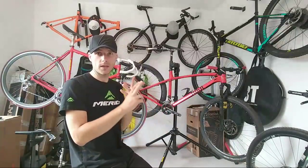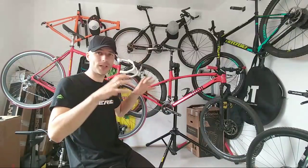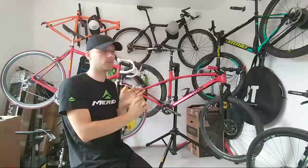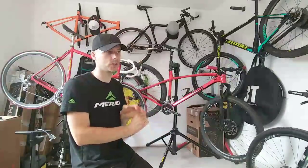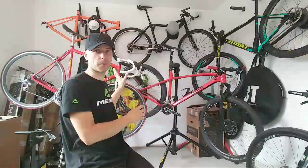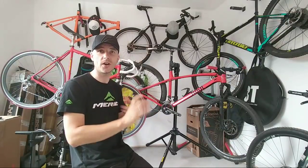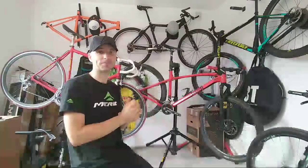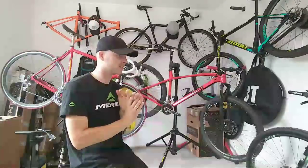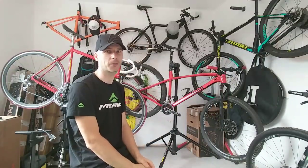Three. The more expensive the bike, the more specialized it is, the more it goes into just one direction, like cross-country racing. It is way too hard for a beginner bike. It is dangerous. Enduro, downhill, or among the road bikes, triathlon bikes and time trial bikes are just not for you. So just know about that. And finally, carbon is not the best material for a beginner's bike. I would really recommend starting with alloy.